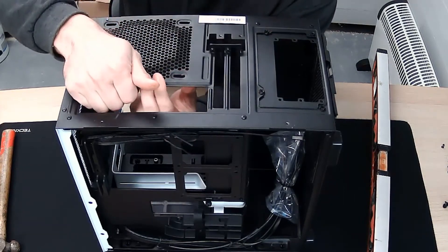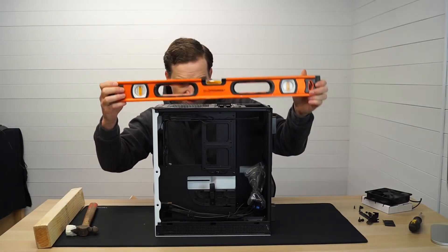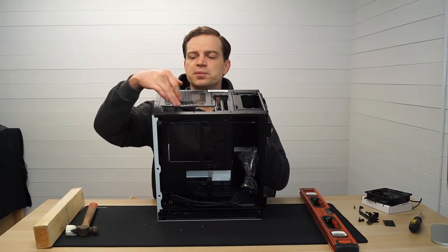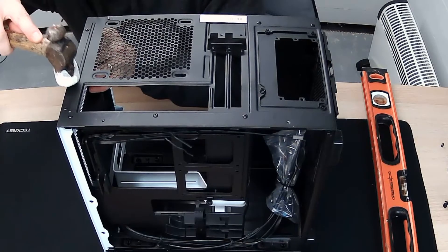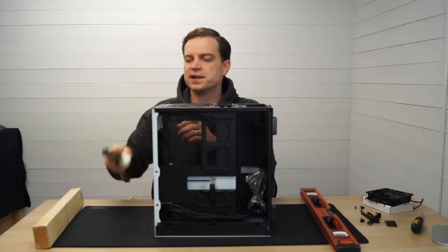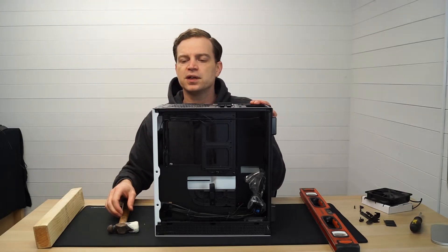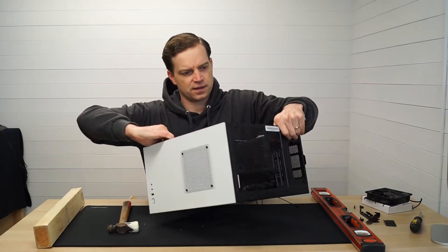We do have this funny shape across the back grille here. It looks as though these are actually imprinted outwards so it's got a bit of a shape to it that it hasn't managed to obtain back. So we'll still do a bit of bending by hand, try to get it back into shape as much as we can, keeping our straight level, making sure we're going as straight as possible. It does need to come out just a little bit more. The actual kinks in this have started to become a little bit tough, and there's a kink in the top which we're not going to be able to push back by hand. So this is where our hammer comes into it and we can start to knock the damage back in. If you do mark this, the back is actually black on these so it wouldn't take a lot to spray it, and I can see there are a few little marks in the actual powder coating.